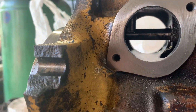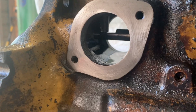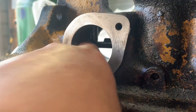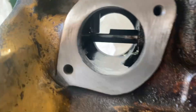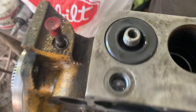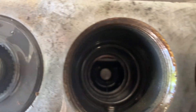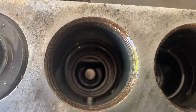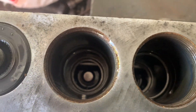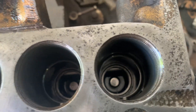Now we're going to put it back with the rack, with the pin in the rack slot. Shut it all the way back to where the pin has it held. Then we'll do number two. I'll probably blow out each one some more with starting fluid or brake clean. I want to be very sure that I'm not getting any debris down in there.